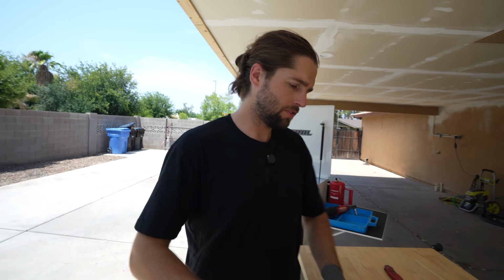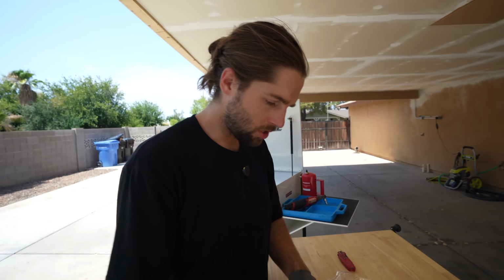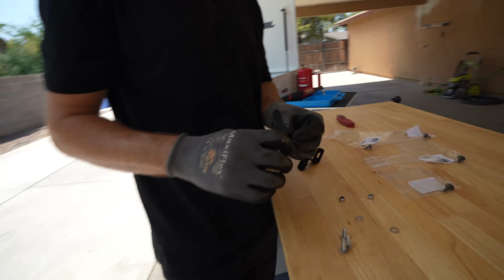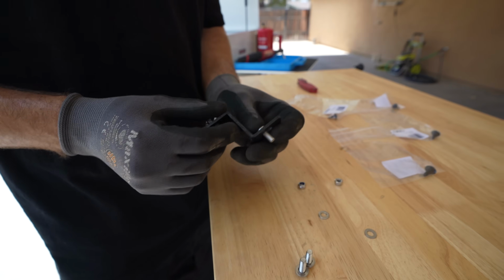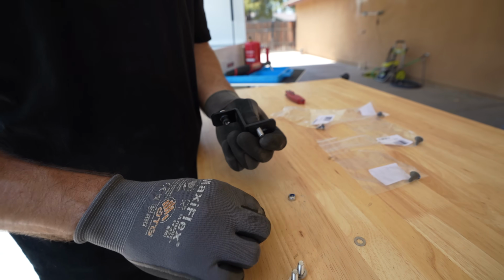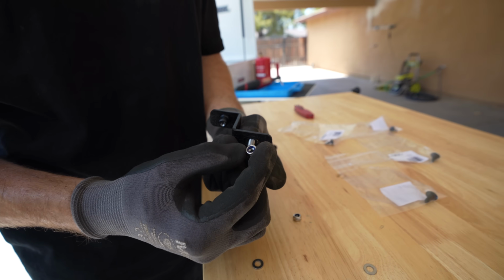The two brackets that keep us firm and sturdy, you need this little hardware bag right here. 4 millimeter Allen head bolts, some washers, some nuts. So these will go in here like that. There's thread here, that's nice. These holes go to the factory mounting spot. We're going to use a bolt, then a washer again, and then these locking nuts with nylon. That blue spot is nylon rubber, so when vibration happens, this thing doesn't come loose.